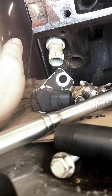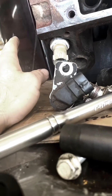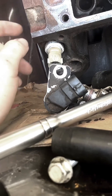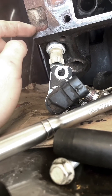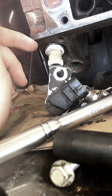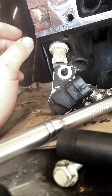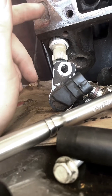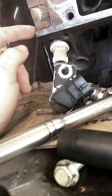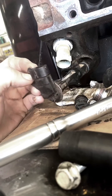This is going to be a little confusing. I technically have a Gen 4 6.0, but the Gen 4 LY6 6.0 I have was actually in a Gen 3 truck, so the only thing it had was Gen 4 pistons and rods. I want to put the 6.0 in a Gen 4 truck and the 5.3 in a Gen 3 truck — that's where the swapping comes in. So here, there's a Gen 4 oil pressure sensor in the Gen 3 block, and the cam position sensor from the Gen 3 needs to stay in this engine.